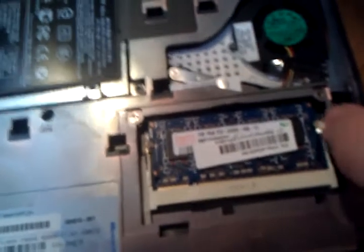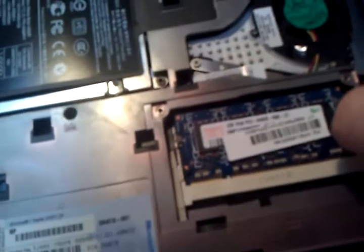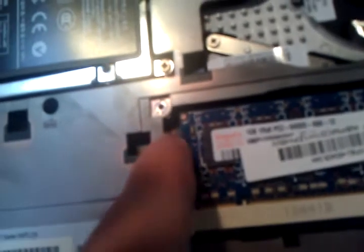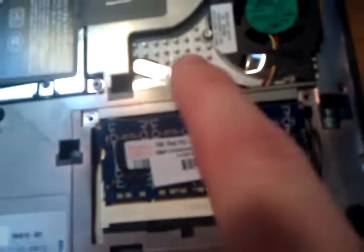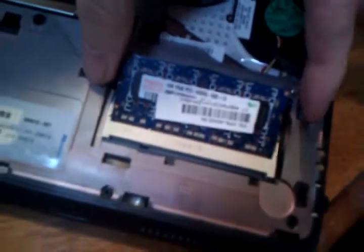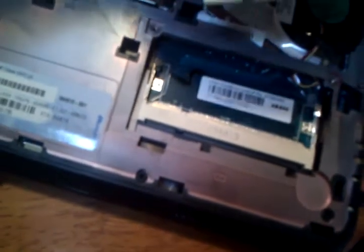There's your memory. From here, push these little pins outward — there's a little pin right here too, a little silver metal tab. Pull that tab out to the left and then out to the right. The RAM will pop up. You don't really want to touch anything on the RAM if you can help it, so just grab the sides of it. It slides right out real easy.